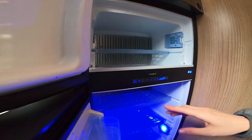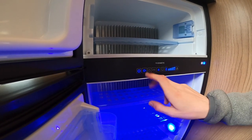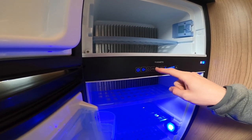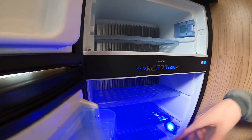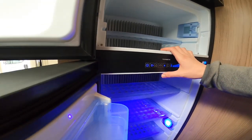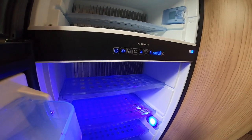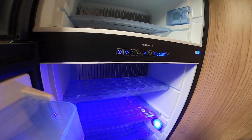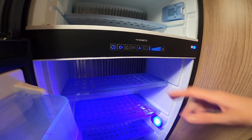For the fridge, you've got on/off, and can run it on 240V electric, gas or battery — battery meaning off the engine via the alternator when running, to keep the fridge at temperature. The A setting stands for Automatic Energy Selection — it picks the best source available. So if hooked up with gas also on, removing the hookup switches it to gas; starting the engine switches it to battery automatically.